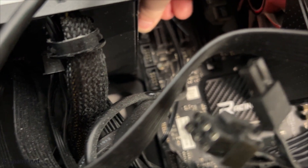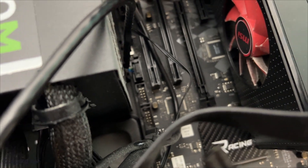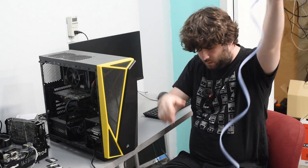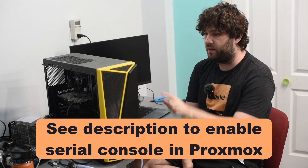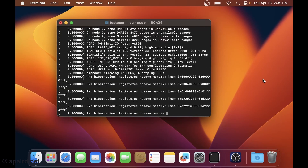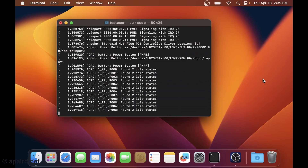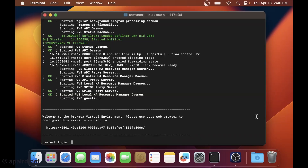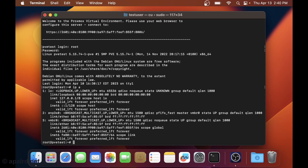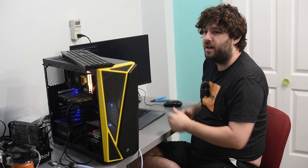Plugging this into the COM header. Now I've got my console cable here. It is another day — I had to come back to this. Let's see what we get. Oh yeah, look at all that console message stuff. So can I log in with the serial terminal? I still have a graphics card in. Oh yes. So if I had a real problem — like for example, I'm rearranging PCI cards and my ethernet stops working — the serial console would be enough for me to get back up and going. If I've got to rerun the installer, maybe I put a graphics card back in. But this kind of support is what I'm hoping for.